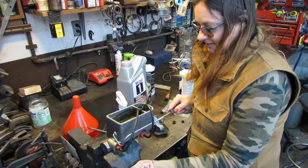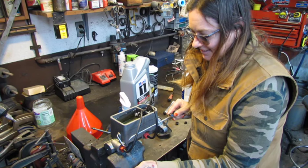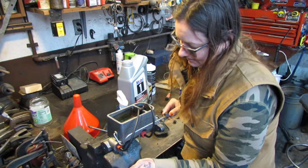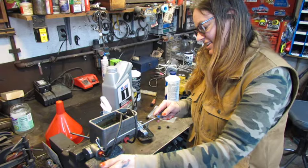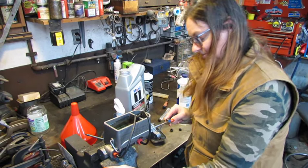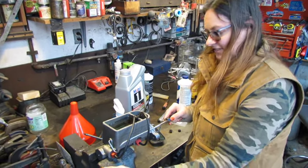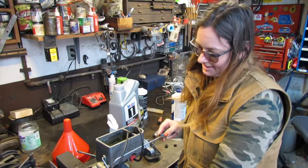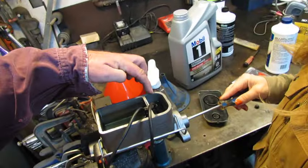See the bubble? Push, girl. That's what you're trying to do. Now do that until the bubbles stop bubbling. You gotta go all the way in. There. Keep doing that. You gotta do it like 10 times or 20. If you do it too hard, it'll squirt you in the eyeball. Well, you got glasses on, so it'll be alright. Notice how the level has dropped in the reservoir.